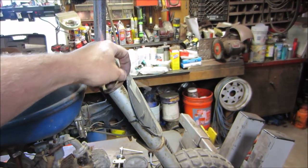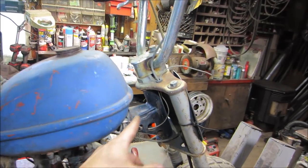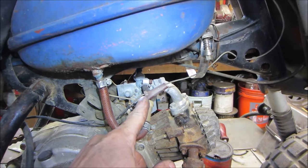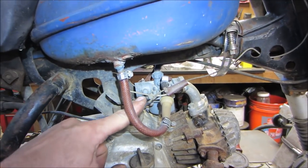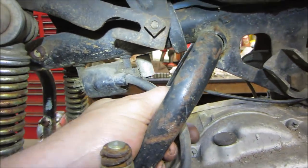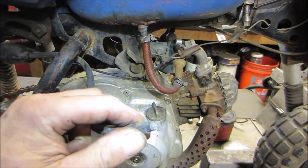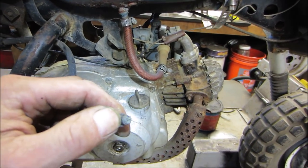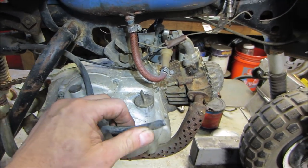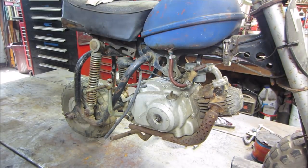Looking at these wires — here is the one that went up to the front of the handlebars, that would have been the kill switch. It runs down and ties in with the coil wire, then the wire continues on and taps into the condenser. The coil and condenser looks kind of iffy too, and our plug wire doesn't have much of an end on it. Let's whittle some of that back and see if I can thread something onto it that we can put onto the plug. Give it a couple of kicks and see if we get some spark.